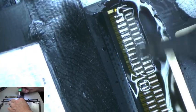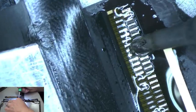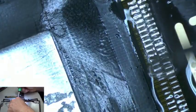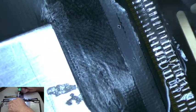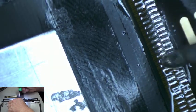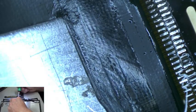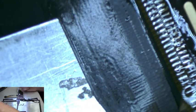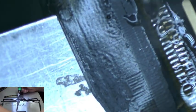As you'll see, this flat tool will start to slide in, and we can turn this over so I can start prying on it just a little bit. Get a little more solder on my tip. It is important to have kind of like a bead of solder like that, so there's more surface area that you're heating up.